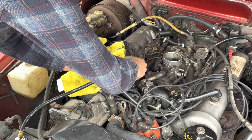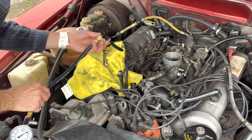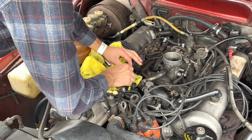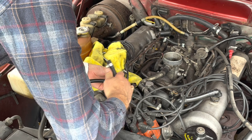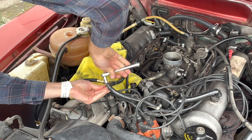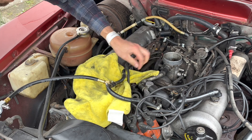There's just a little bit of fuel to come out — obviously there was no pressure in there otherwise it would all come splurging out. There's just a bit of residual fuel but not enough for the car to start. Now we want to put one end of our hose from the kit over the rail and put the other back onto the rail, shove it up as far as it will go — a good inch or so — position the clamp, then take the other end and stick it in at the other end of the kit. I'll just leave the cloth there just in case we get any leakage — they should all be nice and tight.